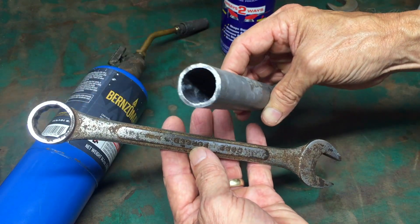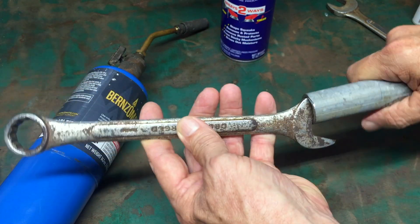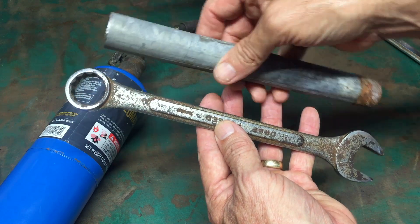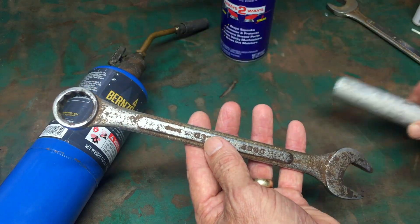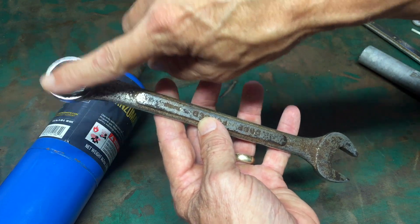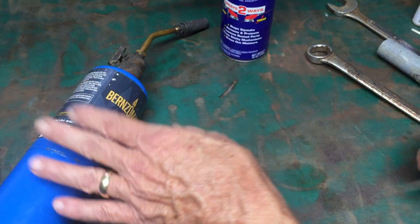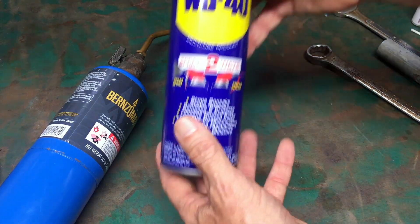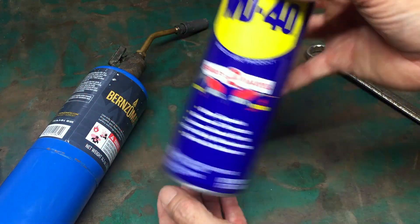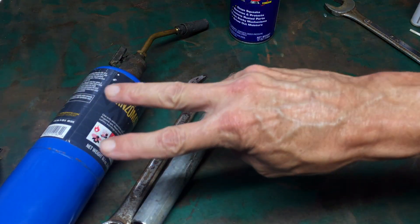For the cheater bar I used a short section of three-quarter inch pipe hooked onto the open end of the wrench to break it loose, then switched to the other side for tightening. You'll likely need more leverage — a cheater bar gives you more torque. I'd strongly suggest using the box end rather than the open end to avoid stripping, and the open end gives you a place to hook the cheater bar. If you don't have a torch, you can use WD-40, PB Blaster, or Liquid Wrench — spray penetrating oil at the base of the sensor, let it soak in, and that should help break it loose. Hope this helps — thanks for watching.